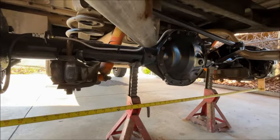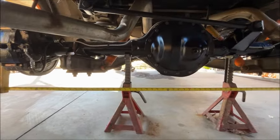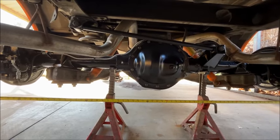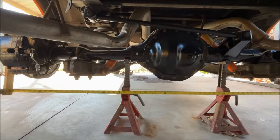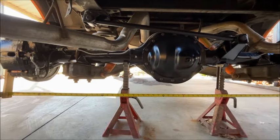So what do you get these axles out of? All of the 90s model Chevy pickups, the 2500 series — and I'm only talking about light duty. If they're heavy duty they'll have the full floater, but all of the light duty will have this nine-and-a-half-inch semi-float rear end, if they are the drum brake version. The drum brakes on these are 13 inches and they are very heavy.